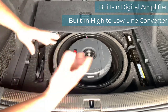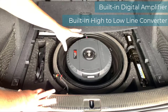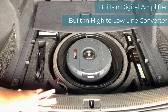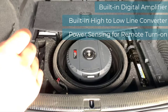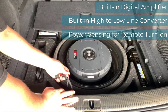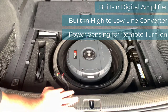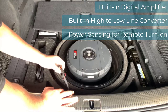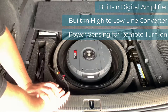What's really cool about that is you don't need an external line converter — you'd have to mount it somewhere inside and also power it to be able to turn it on and off to convert the signal. The next thing I really like is that it has power sensing power-on, which means it takes the signal from the line converter and uses it as a remote turn-on. So I don't have to run a 12-volt power line all the way from my head unit back here — it turns on based off the signal it senses from the subwoofer output.